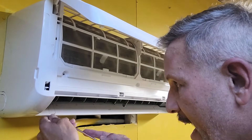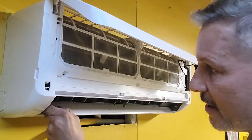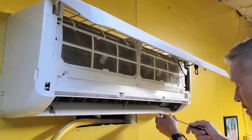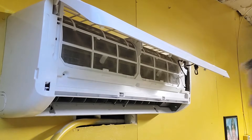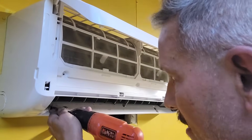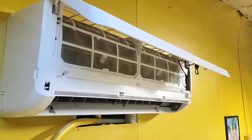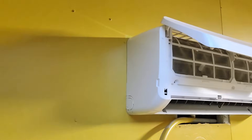You'll see these little tabs down here — pieces of plastic that are covering the other screws. Take a Phillips screwdriver, get in here, and wiggle them a little bit — same with the other one. That screw was already loose, so that's a gimme. Your work is pretty much done, except there are also plastic tabs up on the top, so you need to stand up and get at those and get those loose as well.